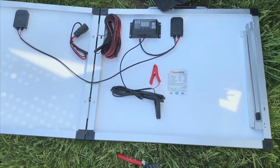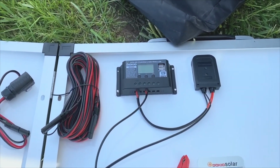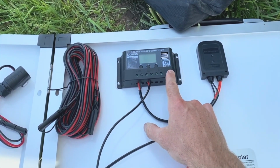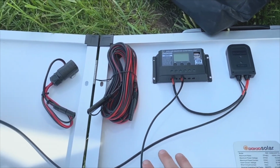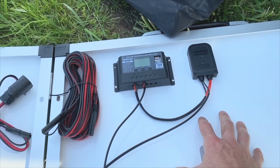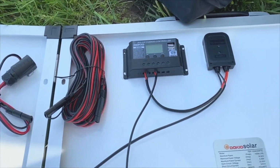This is the back of my solar panel. The Furrion plugs are just wires that run straight to the batteries, so whatever solar panel you get has to have a charge controller already on it, or you can get a separate charge controller and do it that way. And the wires aren't very big, so you can't put more than one ground unit, or maybe two, before you burn out a wire somewhere.